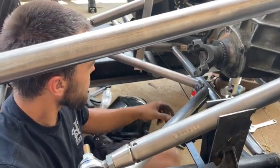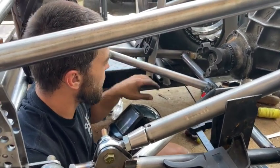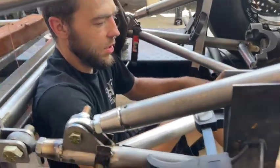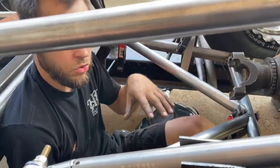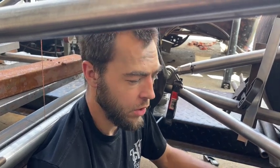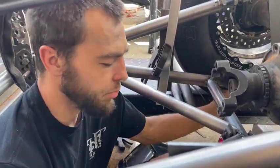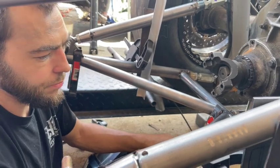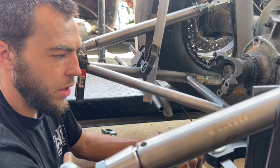I made these bars up — all inch and a half, 0.120-wall chromoly — and the bracing is all inch and a quarter, 0.095-wall. I'll add one more brace in here; this will have about four inches of weld around it, all nice and tight. And there are times when you can add rear steer by cracking this loose and putting a flat or a couple flats in it.